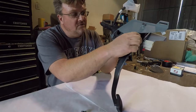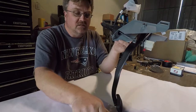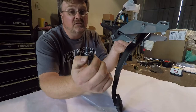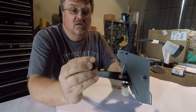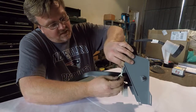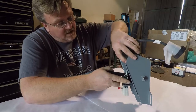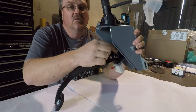What I've done is gone and bought the Wrangler bushing. This is a fairly complicated molded plastic piece — they're not the cheapest things in the world. I paid seven bucks for this one, and that's one of the cheapest ones I've seen. We have our Wrangler retainer clip, and that will go into the ZJ clutch actuator arm. Press that in, then slide that over the pedal assembly, like so.